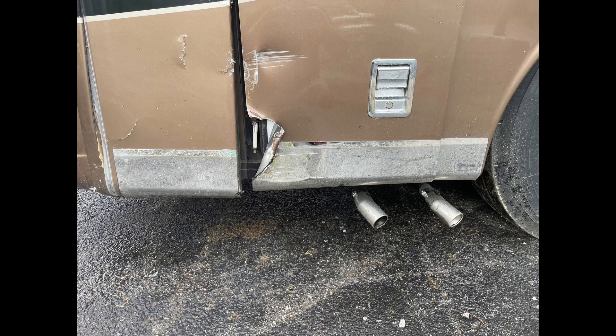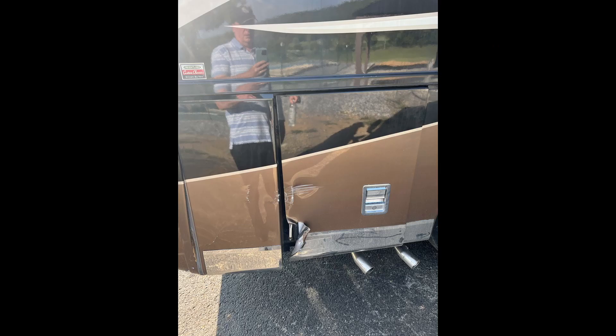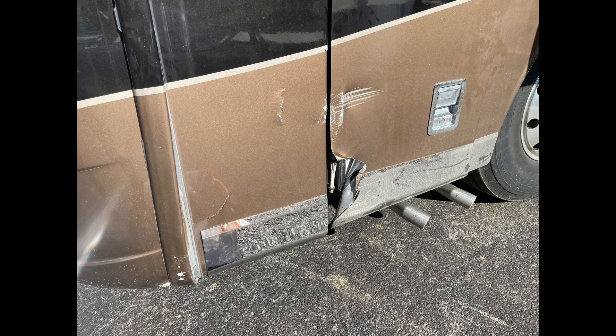We're going to fix it. The panel on the left is a fiberglass panel, and the panel on the right is actually a door and it's clad with aluminum — so that's the challenge we have here. There's also chrome trim along the bottom, and we are going to replace the two chrome trim pieces. We were able to source those from the RV manufacturer.